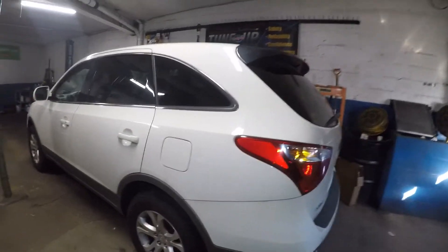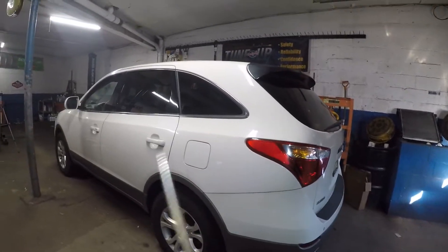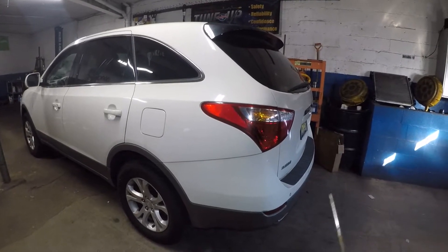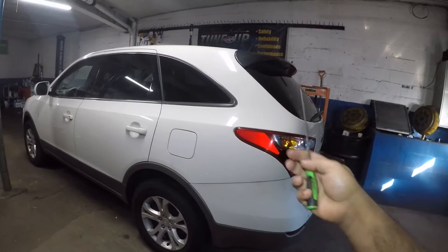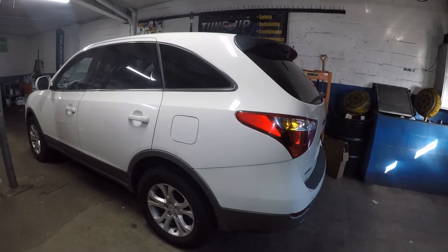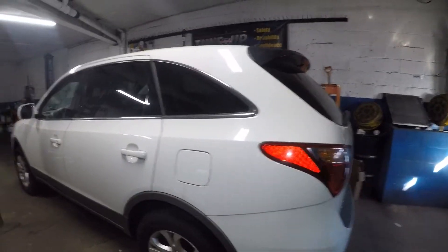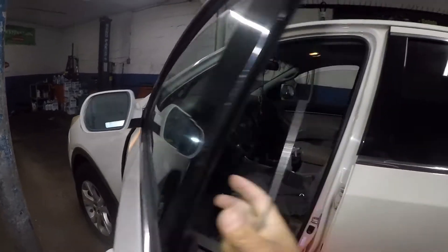Welcome back to the channel. In today's video, if your brake lights don't work, you'll want to check your fuse. Same if your radio doesn't work. And if your cigarette lighter doesn't work — that's very common if you're using a pump or some accessory that draws heavy voltage from the cigarette port. A lot of amperage can blow the fuse. Let's get inside and I'll show you all three fuses, their locations, and the exact fuse to look at.